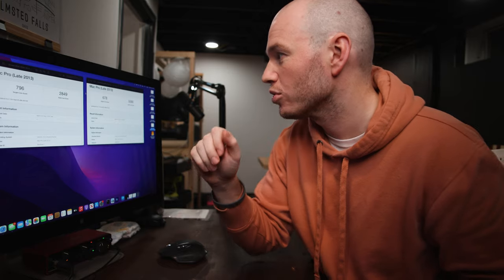I'm downloading some benchmarks to see just how much better this $35 CPU upgrade and roughly $500 GPU upgrade actually help, and whether you should consider it if you have or are thinking of buying this machine. I ran preliminary benchmarks on the Mac Pro 2013 — thankfully before I upgraded, because I'm not taking it apart two more times. The single-core score on Geekbench 6 with the four-core processor was 796 and the multi-core score was 2849. With the 12-core upgrade, the single-core dropped to 678 — about 15% degradation — and the multi-core jumped up to 5090.